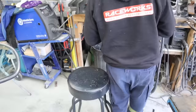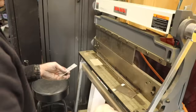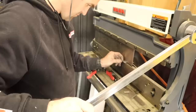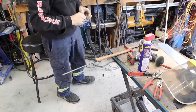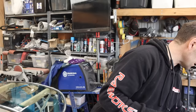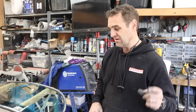I started by roughly cutting the correct width and cleaning up the edges of the aluminium trim, then put my two bends in it, trimmed off the excess, and manipulated it by hand to get the exact right shape. There's my little piece of aluminium bent up - that should do the job. Here's an unpolished stainless one too; the stainless one's a little bit thinner but this will do. So let's call the windscreen set up and ready to install and get the rear window to the same point.